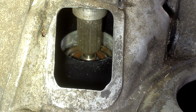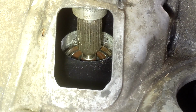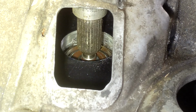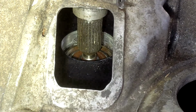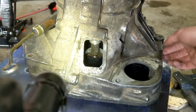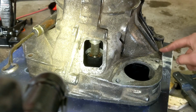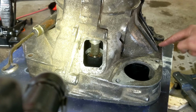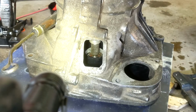perfectly again. So it's hard for you guys to see, just because it's a phone camera, but the shaft's moving and the bearing's not. Took me a little bit longer this time to get it in the right spot. So what I forgot to do, what I should have done first, is there's a dowel right here, you can't really see it, but there's also a piece of webbing right above it. So I'm gonna angle grind out this webbing here so that I can just get my holes nice and accurate from this position it's in right now.